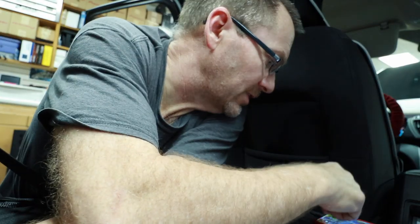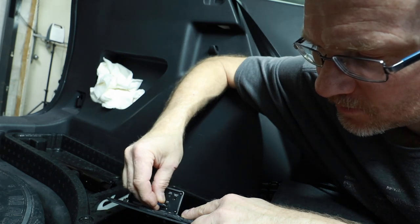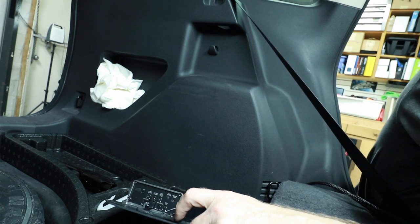Press and hold the KEY button for three seconds until the gain match LED flashes — and it flashed. Start the track with the gain knob all the way down, then slowly turn the input gain clockwise until the gain match LED lights up, then turn it back down until there's no longer any flashing. We find the right spot — no more flashing. Once the gain is set, stop the track and press the KEY button to exit the mode. Our gain is set.